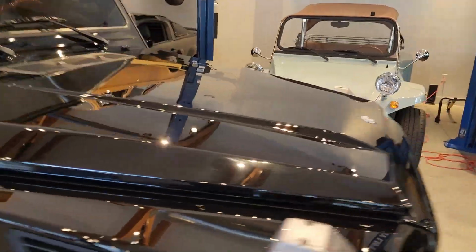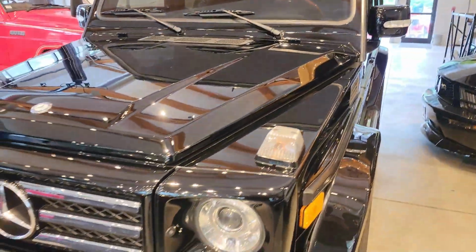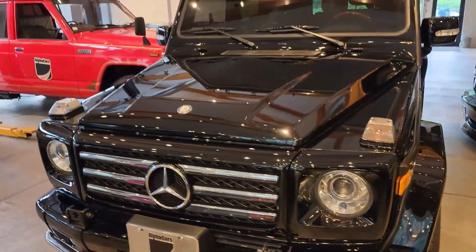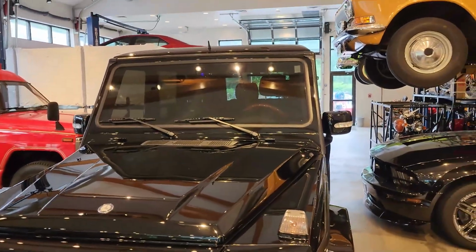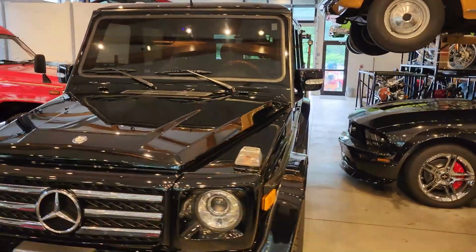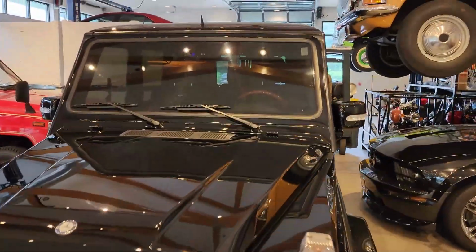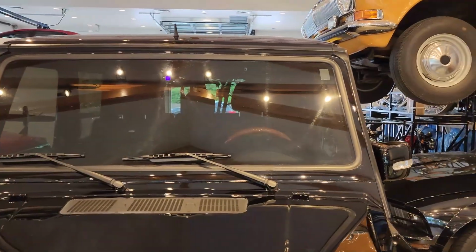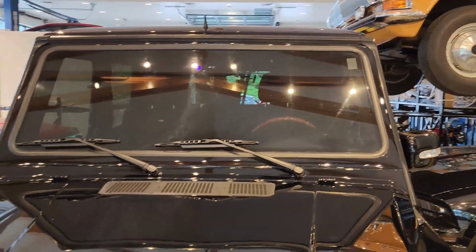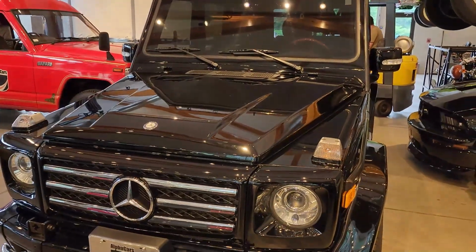So this vehicle really has the full film protection package, especially, of course, the front end of the vehicle is very important, especially the front of the hood, but really the windshield frame, those door, window frame edges, that is really where it'll cause the damage. It'll cause the big repair bills when that rust really gets into places like the windshield frame. So now this vehicle is going to be prepped and have the ceramic coating application done next.